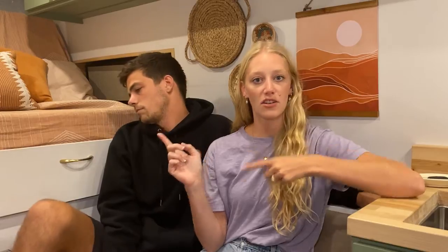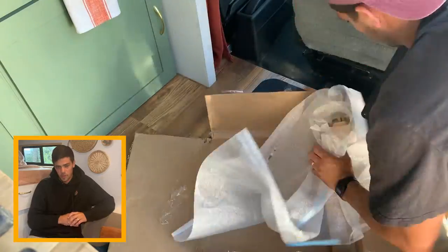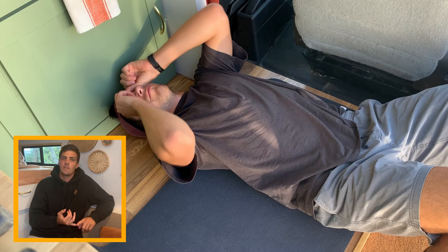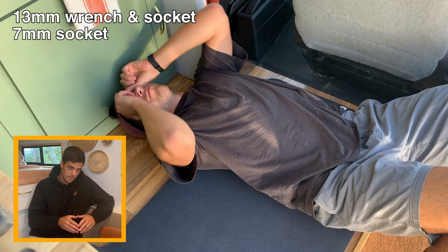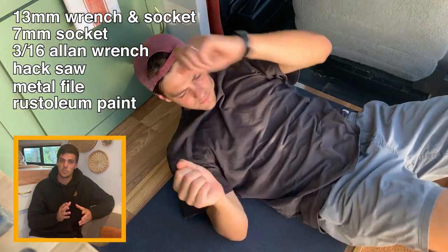You can't review something very well until you install it — if it's still in the box, it's not a great review. First thing you're going to want to do is open the seat swivel package. You'll quickly notice this package is extremely heavy, because it is just metal and more metal: the swivel itself and the hardware. What will you need to install this? A socket set, a 13mm wrench and socket, a 7mm socket, a 3/16 allen wrench, a hacksaw or saw with a metal blade, a file, and rust-oleum paint. That allen wrench could also be swapped for a star bit.